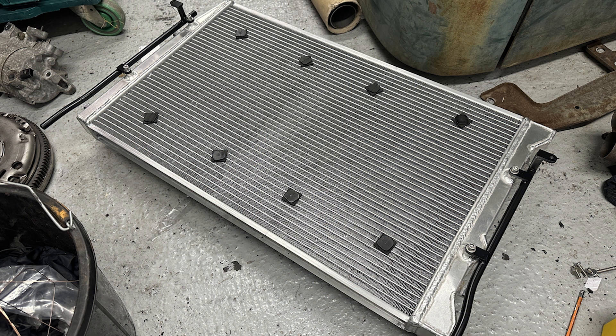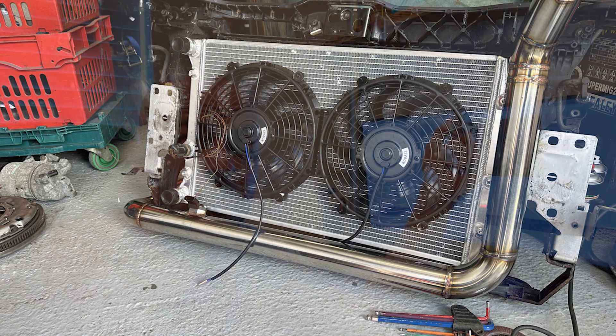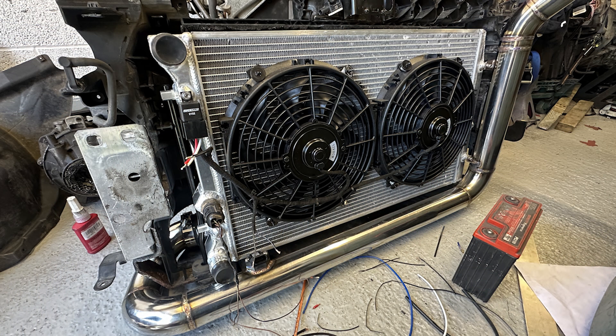As an afterthought, I realised I didn't touch on cooling. The radiator I'm using is a Fabia VRS one — I was going to use the Audi A1 radiator, but they don't do a race-spec thicker aluminium radiator for either the S1 or A1. I've made some mounts and it fits perfectly, and I can get a bigger cooling radiator. With the A1 fan plug, the ECU controls the fans and picks up temperature from somewhere other than the radiator itself, so you have to wire in a manual switch of some degree. For the VRS radiator, instead of using the dual-speed VRS fan switch, I've used a different fan switch that screws into the radiator.